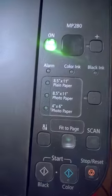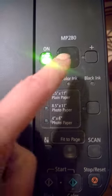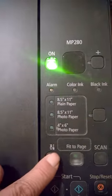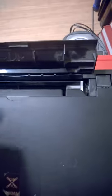You leave the printer on — this is the MP280. There's a button here you push until it shows 'B', then you hit start with no other paper. There's a rotor that keeps rolling; you just force it all the way in and it will come out from the other side.